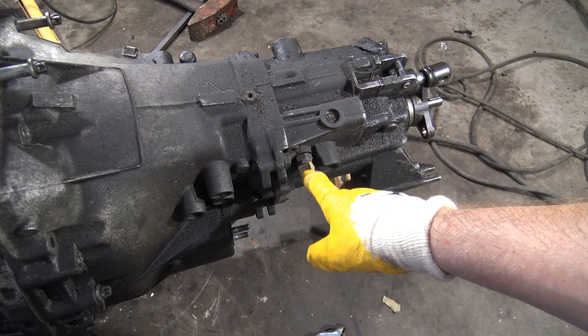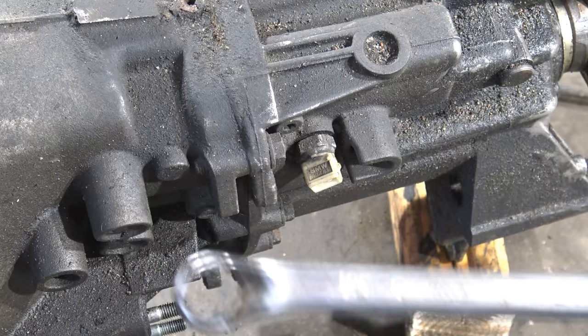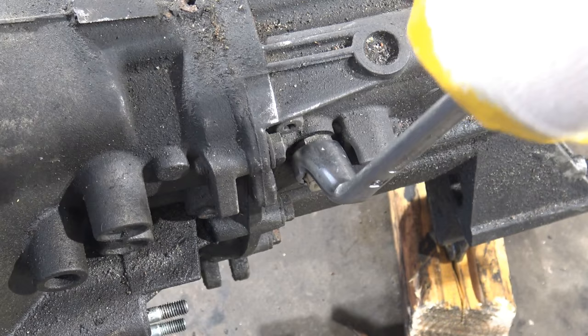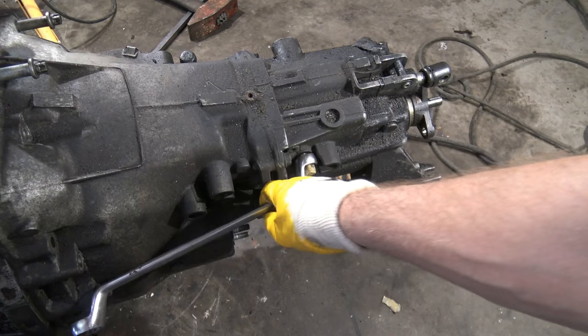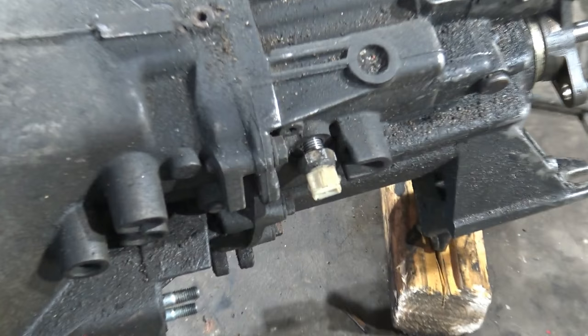Here is the reverse light switch in that position. For that opening I need this wrench - what size is this? 19 millimeter. I insert my tool in this position in here. The opening direction, when we have the gearbox, it is that way. I insert it normally in this down area and then rotate it open in this way, and then it is easy to open.